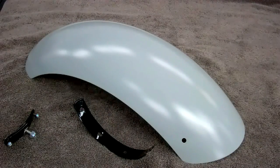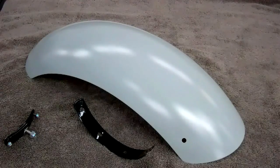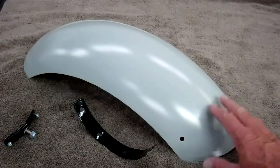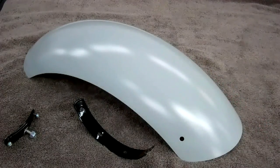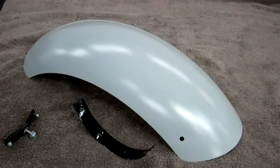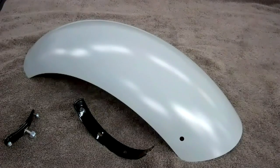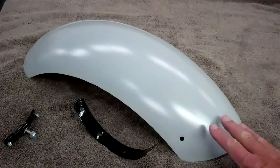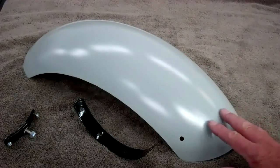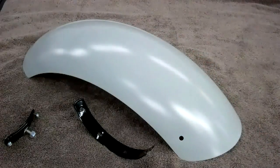This is just a quick note about our new fenders. The fender you'll see in the video is the older fiberglass one — these are the new ones you'll receive. They have a powder-coated finish, so all you have to do is just barely scuff the surface and they're ready to paint. If you get the bare aluminum version, finish it off with a Scotch-Brite pad or a pot scrubber with a green 3M pad, going lengthwise to remove scuffs and scratches. Use hot water and soap and go lengthwise to get it looking like nice brushed aluminum again.